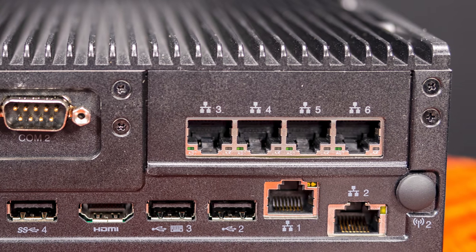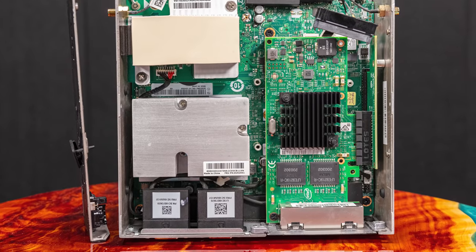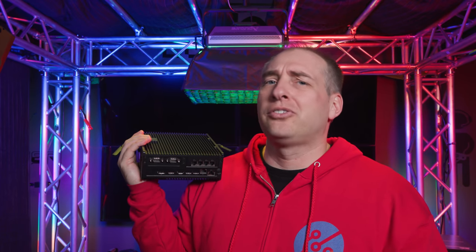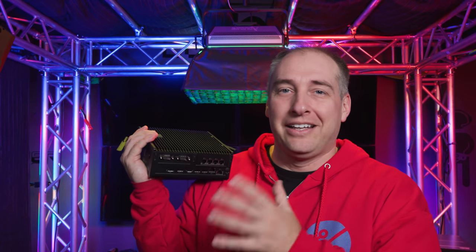There are actually four one-gigabit Ethernet ports based on the Intel i350, and we'll look at that card in a moment. Now, you might be saying you wish there was 100 gig Ethernet or a DPU, but you have to remember those can be pretty hot devices — 65 watts or higher — whereas the TDP for the CPU in the system is about 15 watts. You just don't have enough cooling to accommodate something like that in a chassis like this. Gigabit Ethernet is perfectly okay for a lot of industrial applications, though I would have liked to see 2.5 gig Ethernet on a 2021 product.